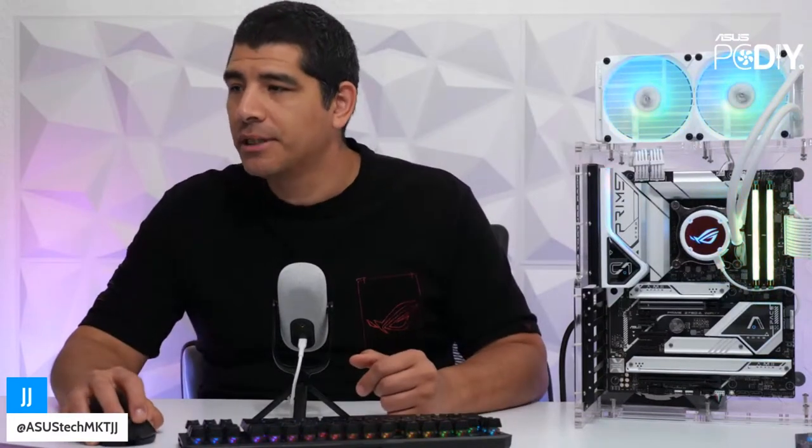So you always want to check the dimensions, check the tech specs. Don't go off the image, because even some media have incorrectly reported that it's the same cooler, and it's not the same cooler. The cooler actually gets revised. Take for instance the 4090 compared to the 4070: the 4090 will have more heat pipes, and it even has things like a milled vapor chamber design. So there are different design implementations respective to the GPU that it's being used on, okay?